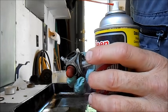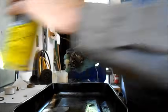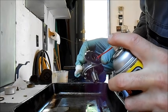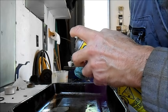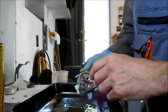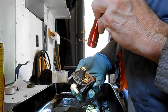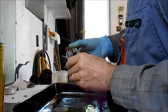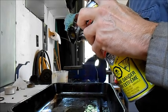I'm having a hard time finding the clog in this carburetor, even using my little 90-degree carburetor sprayer. I don't like to get too much carburetor cleaner on the rubber parts inside because it can dissolve them. Now I'm going to shoot some carburetor cleaner into the one jet halfway down the threads, right there. I saw it come out the idling circuit, which is good.